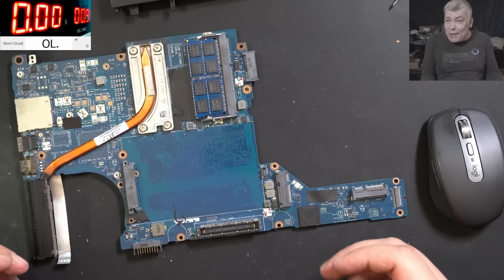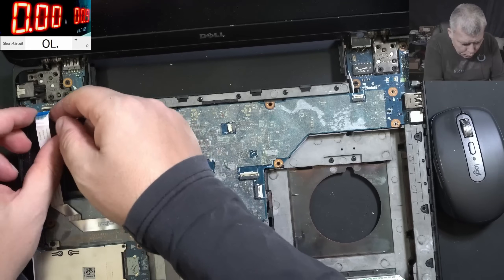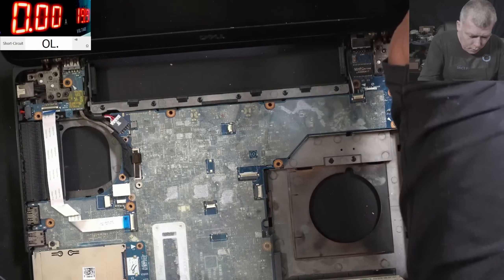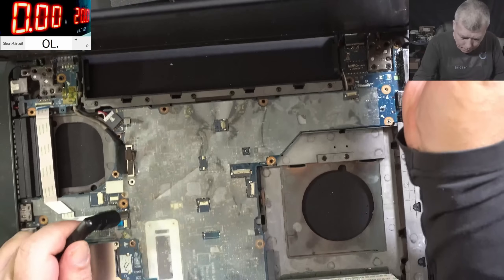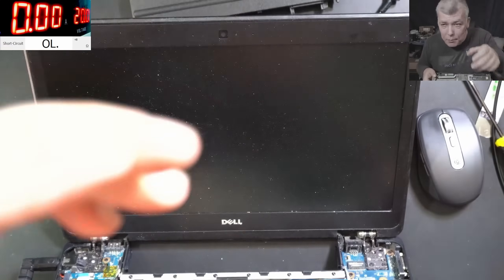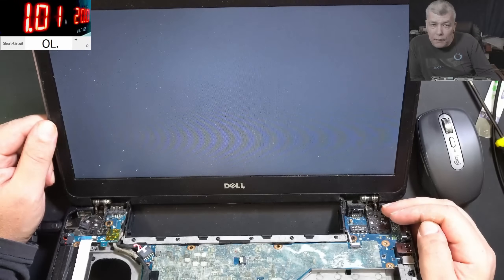Replacing the capacitor — of course I'm going to replace it, but not in this video, maybe on a different one. So we have the screen, we have the charging port. Let's plug the charger and try to power on the laptop. 19 volts. Plug in the charger — check there: 400 milliamps. That means the motherboard started. 600. It's going to zero because we reset the BIOS — we unplugged the BIOS battery. 600 going to zero, and that's normal. Let's wait.